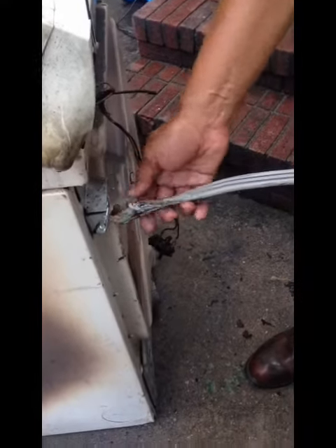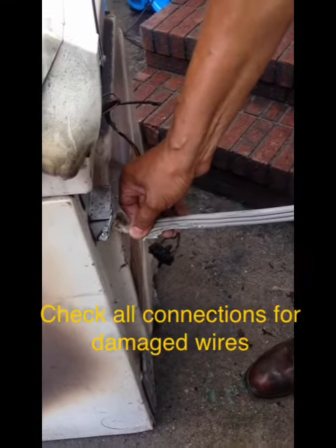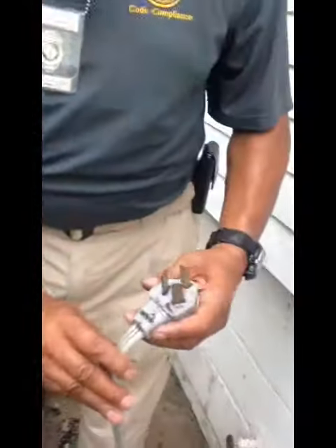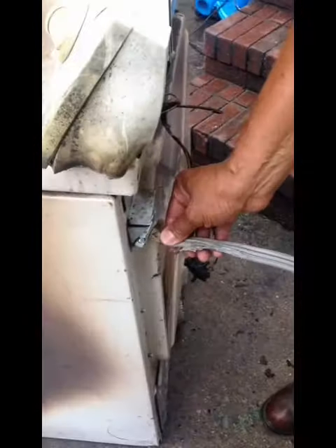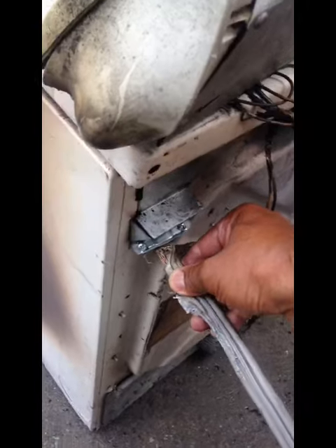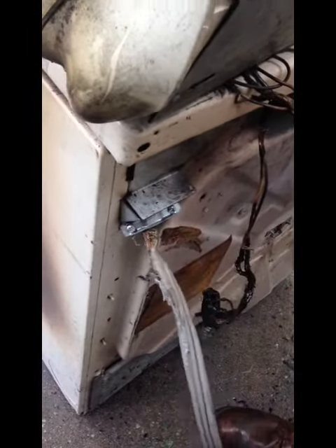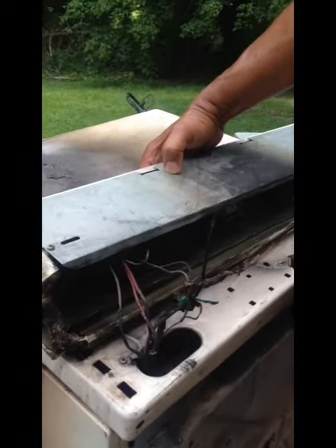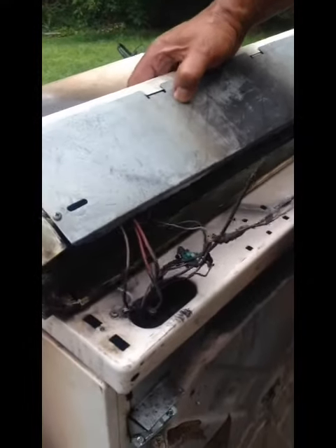As you can see, there are exposed strands of wire that can have current on them, which can cause an electrical short. The plug-in itself is intact and tight, but be sure to check your cord and make sure the collar is locked tight into the back of the dryer. Also, looking at the back of the dryer, you can see where all the electrical components did burn and catch fire due to the current rise going through it and the short.